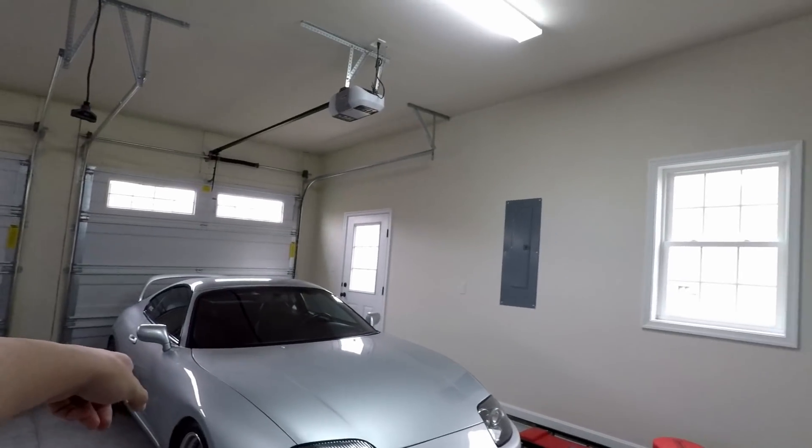I took the old girl out last night — I wish you could have been along. Too dark to see anything, but I took her out to try and enjoy it a little bit. Running into an issue though. I think I have a broken motor mount or some kind of mount is broken. When I take off in the car, it doesn't quite shudder but I feel like everything's moving — you can feel the engine moving or the rear end moving — and that's with solid mounts in the rear. I'm going to jack it up once I get another set of stands, put it up and check the motor mounts, all the bolts, and the trans mount to see why it's moving so much.